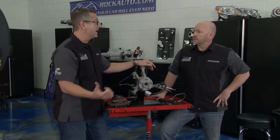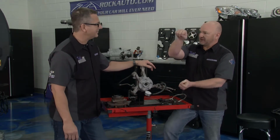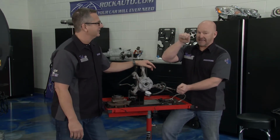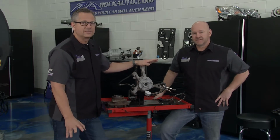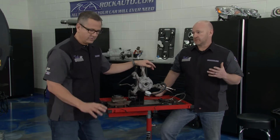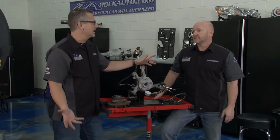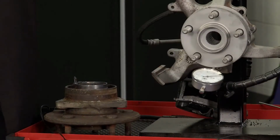Well, what about our Maxima, though? I mean, that was a tough bearing. That was substantial. Remember the clunking on the 12 and 6 o'clock check? I mean, you could feel it and hear it. That was bad. That was rough. Yeah. But using that press made easy work of that job. Yep. Put it back on, took it for a test drive, rumbling was gone, went ahead and did both sides. If that side's that bad, Dustin, you probably want to do the same thing, address both sides of the car.